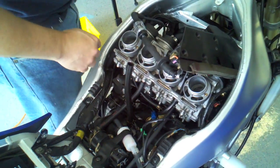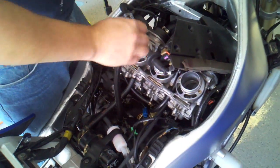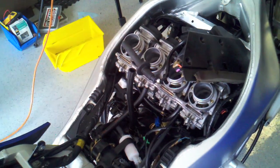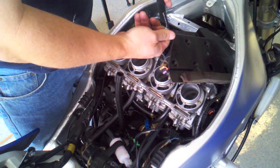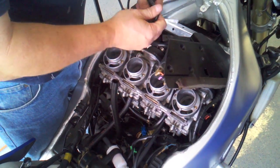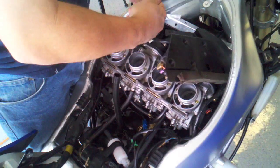So, if I feel the header pipe, oh yeah, it's hot now. So that's good news. That just means that the only problem I was having with cylinder 1 not running is a connection problem in the boot here. So I need to go through this thing and figure out why it's not connecting reliably, but that should be easy. The next problem is going to be the sound that's coming out, that screeching.